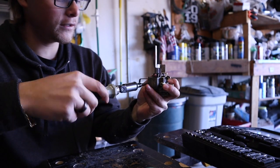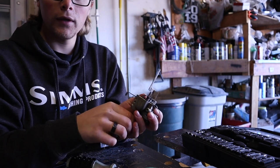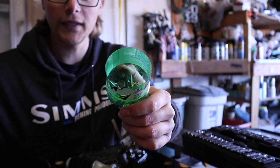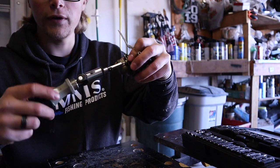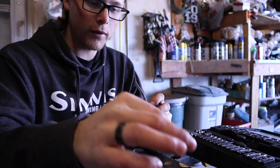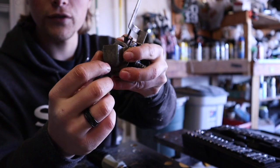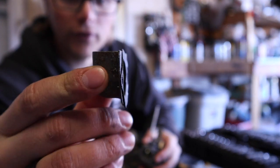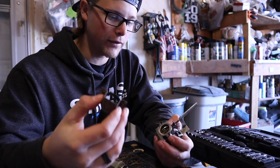I have no idea why whoever designed this decided to use star bits, but so be it. There are two screws on here — use your bendy screwdriver and get those out. An important tip: you don't have to have an expensive magnetic parts tray; you can just use the bottom of a soda can. Put the screws in there so you don't lose anything. There's a little gasket on the other side of this piece — don't lose that. It should be pretty stuck on there; if it looks too worn you might have to replace it.